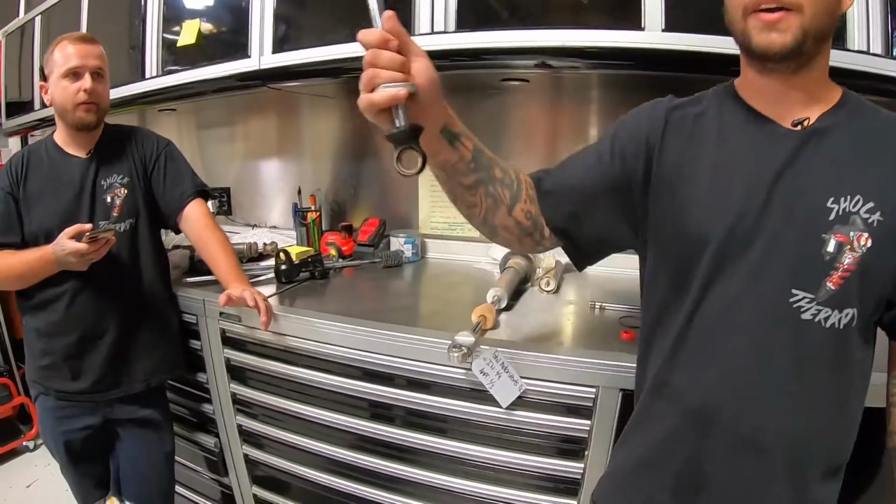And that's always best case scenario. Yes, right. As long as I have everything. If there's a part that is destroyed, a seal head that we're back ordered on, a shaft or anything like that, it could change that. Best case scenario, seals, oil, shocks back to them. 1 to 2 weeks is kind of a tricky one because you see shocks that come in that are just a seal. You throw a seal in the seal head and new oil and freshen it up, it's out the door. Then you get a shock that comes in that's body's worn, popped out of the shock, and it's missing a bunch of parts and the body's exploded, and the term rebuild is used, I think, very lightly on that side of things.